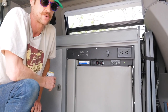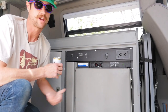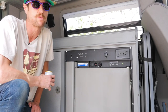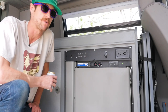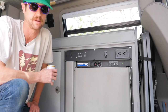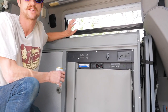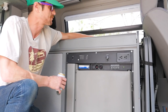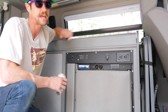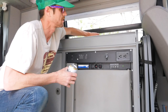The third thing about the refrigerator is it does need to be level to work. You are going to be level at your campsite, hopefully — everyone wants to sleep on a level bed. But just keep that in mind when you park at a visitor center at a national park or state park. Find a level parking spot if you're going to be lighting the fridge on propane. The refrigerator is venting exhaust gas outside, but it is going to produce a little bit of heat behind it. So if you feel heat coming up from behind the galley right here, that's totally normal. You can always open the vent window and let a little fresh air inside.